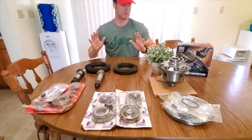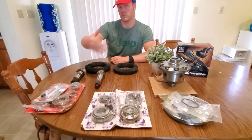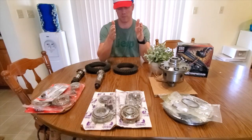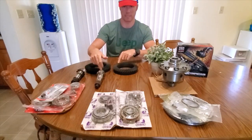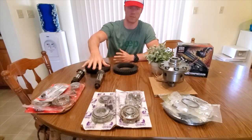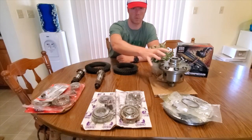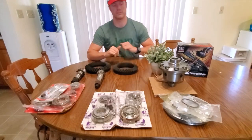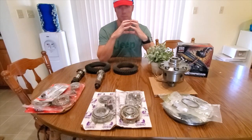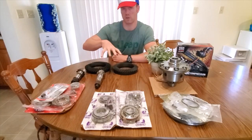So if you're going to order gears — this is new-guy talk here — order your front and rear M210, M220, and your master install kit. Because whoever's installing your gears, you're going to want those extra shims that I showed you with the locker. They're little shim packs that allow you to set the locker in the diff and line up your pinion and ring gear perfectly. Gears and install kits are going to roughly run you $800 to $1,000 just for this stuff. I've also got something in the works for a 35-spline shaft rear, with set 80 bearings on the outside of the axle for bigger tires.